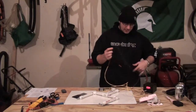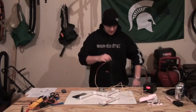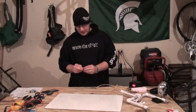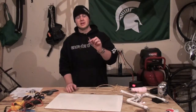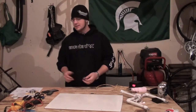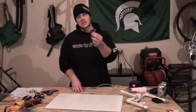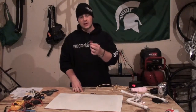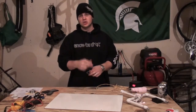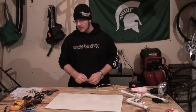Take care that the wires don't get tangled, and you don't want this to touch itself because you're going to lose all your length in that wire. A lot of these snap-on connectors are rated for 18 or 16 gauge wire, so they won't hold on to this resistor wire that well. Just fold the end a couple of times so you can crimp it and give yourself a little bit of meat for it to pinch down onto.